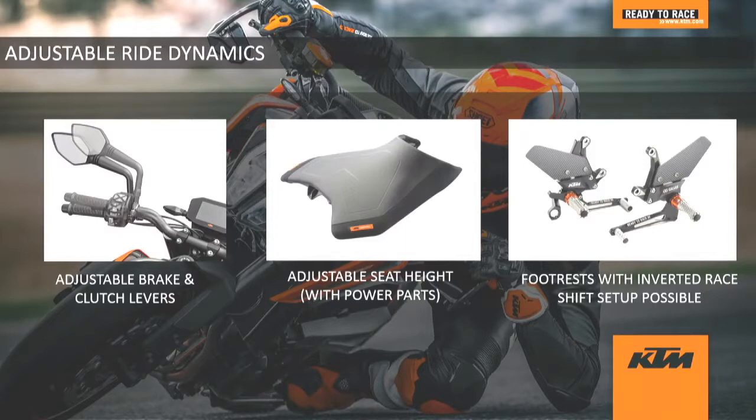The 790 Duke also allows multiple adjustable features, helping subtle variations make a huge difference in the ride feel. The handlebar is adjustable in 4 positions as standard and can be rotated to a further 3 positions. Both brake and clutch levers are four-step adjustable as standard, and the position of the footrest can be adjusted as per the rider's choice of gear pattern. Along with that, the seat height of 825 millimeters can also be adjusted by 20 millimeters either way through a Power Parts accessory program.